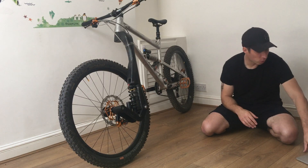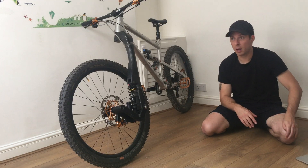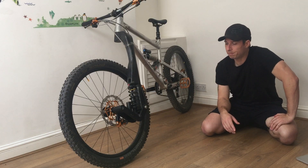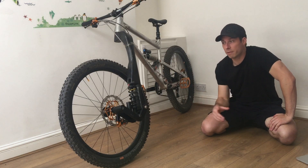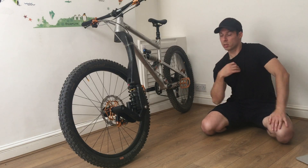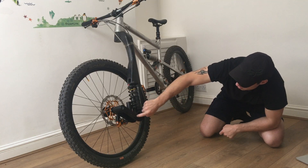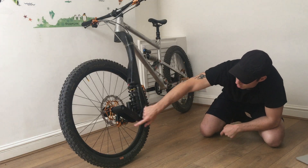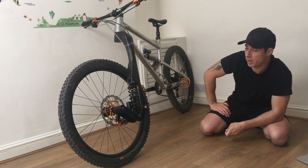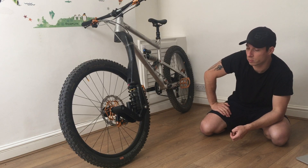In the fourth part of this video, we're going to talk about the upcoming second prototype and some design changes I've made to this one after riding it for about eight or nine months. The major change is I've actually gone to two-sided, because this fork has a lot of anti-dive. The brake caliper is bolted directly to the link, so whenever the suspension cycles, the brake caliper rotates around the disc a certain number of degrees. When you're braking and generating anti-dive force, that's where that anti-dive force comes from.